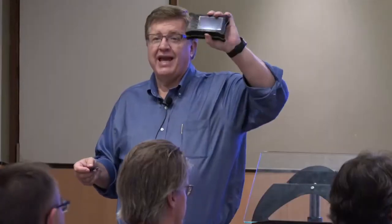So this by itself is an endpoint to test to. It's also a Linux computer. Adrian Granados makes some great tools. One of his tools is Wi-Fi Explorer. If you have Wi-Fi Explorer Pro, and you put this in, and you hook it up to Ethernet, you can leave this behind at a customer site or anywhere you want, and with Wi-Fi Explorer, talk to it. It becomes the eyes and ears for Wi-Fi Explorer. So you have a remote sensor all in the same little box. If you want, you can plug an Ethernet port in one side, put the Wi-Fi NIC in there, and this is also an access point. If you want to run it that way, it has that ability.